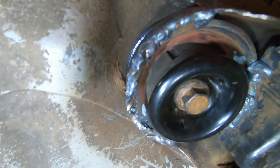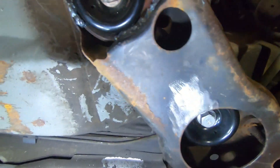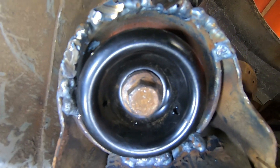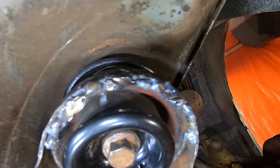You can see it's all nicely tucked in there and the bushings fit really well. I was quite careful with the alignment of that new cup to make sure it was centered in the hole — I matched it up with the other side. I got those all tucked up in place and then torqued them to 66 foot-pounds, let them sit for a few minutes, and then re-torqued them just to make sure I hadn't missed anything. It's all good.